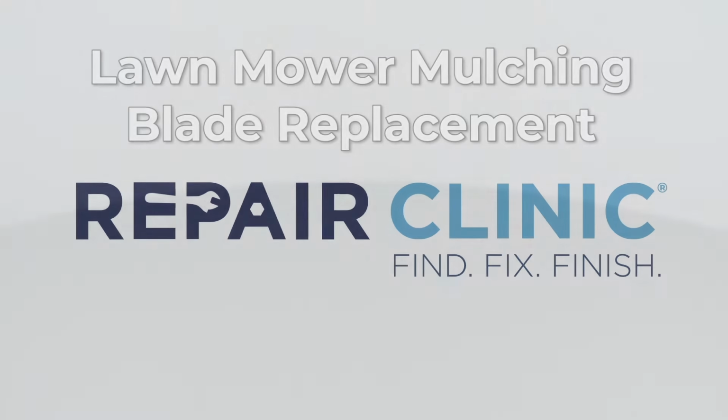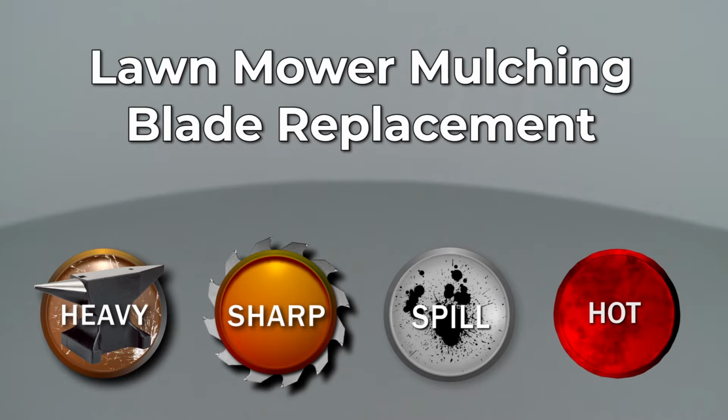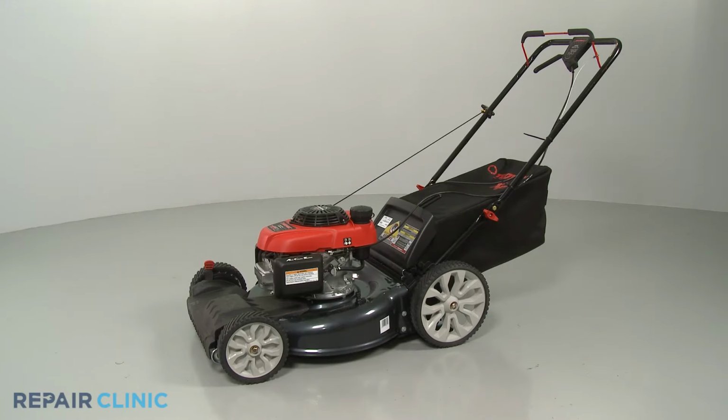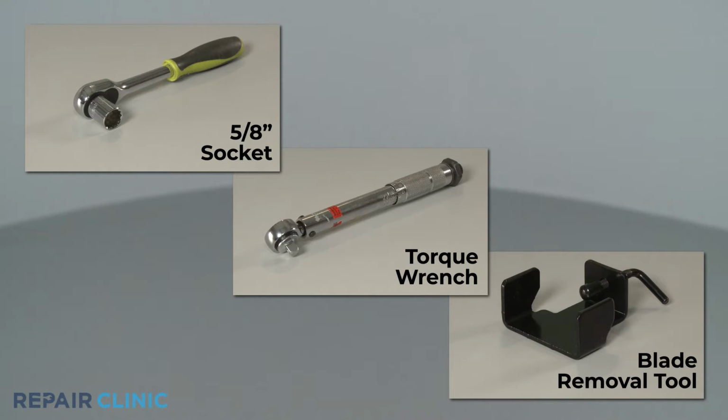Since Repair Clinic encourages you to perform this repair safely, a warning icon will appear when you should use caution. To replace the mulching blade on your Troy-Bilt lawn mower, you will need a 5/8" socket, a torque wrench, and a blade removal tool.